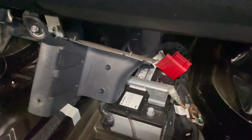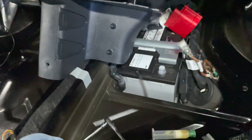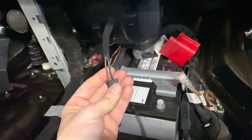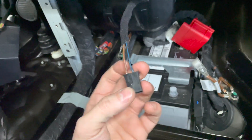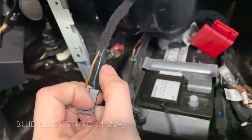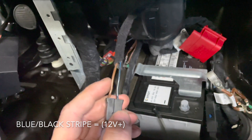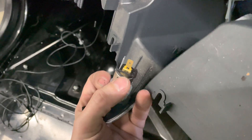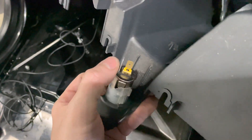What I'm going to do is wire a 12-volt socket adapter directly to the standard 12-volt. You're going to find this blue and black cable — the one I'm touching with my thumb. The blue and black is the positive terminal, and the brown is the negative terminal. The center of a 12-volt socket is always positive, and the outside is always negative.